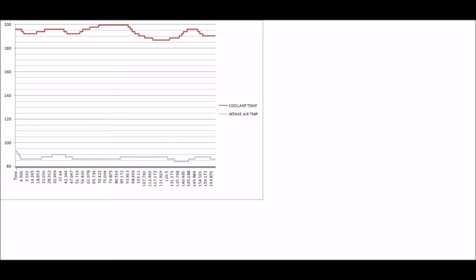And the third thing is the type of road course that you're planning to do. That also plays a big factor, and I'm gonna give you an example. I just did a road course / time attack event at Road America like 2 weeks ago, and the temperatures over there were between 60 degrees to 72 degrees Fahrenheit. I didn't get a chance to monitor it all the time, but the couple of sessions that I did monitor, the coolant temperatures didn't get above 200 degrees Fahrenheit. One of the big factors is this racetrack has multiple sections where you're running the car above 120 miles an hour, which helps big time because that's getting a lot of airflow.